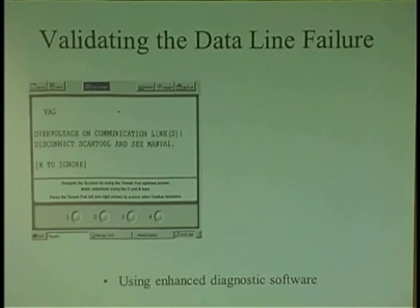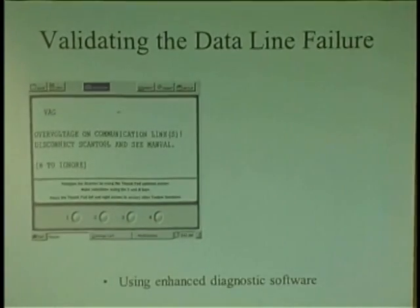Also, these grounds, you better make sure both of these grounds light up. I'm going to tell you why: certain scan tool companies can use either ground to toggle the data lines. When you command something of the scan tool, it'll use this ground to toggle the line going back to the computer. So you can have one bad ground and your scan tool may not work. Another guy could use a different scan tool, and his works because it's using the other ground. I've already seen it. So it's just a nice quick tool.